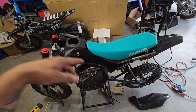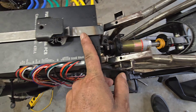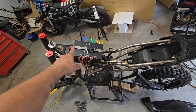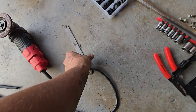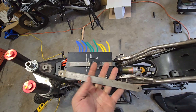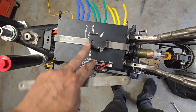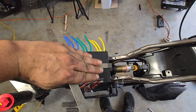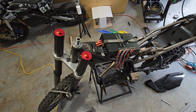We got our little tabs on the end - it bends up, bends back, goes across, does the same thing, bends down, bends out into a tab. I made it a little too short so the sides were bowing out and I had to cut it in half. Here's what's on the bottom - that's just right on the bottom of the controller. We got a nut and a bolt right there and it just grabs around the controller. My little tab piece is just tacked on there for now, so I'll pull this off and weld it nice and tight.